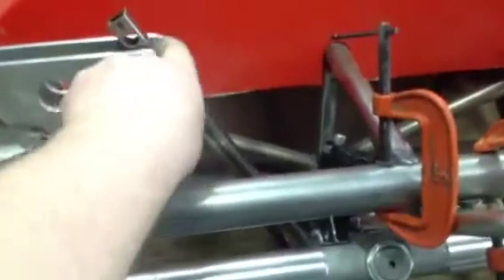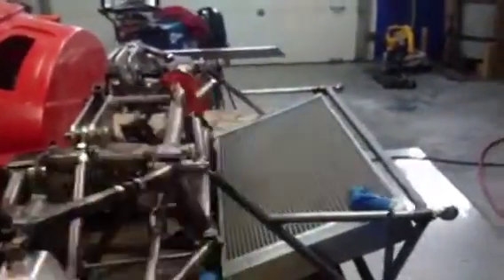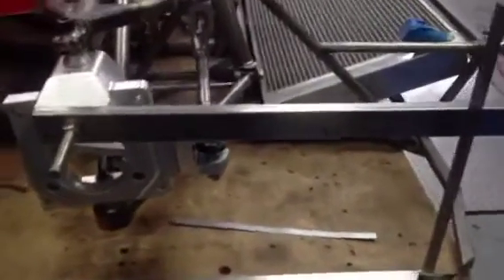This one's courtesy of spacers; this one has a ride height bar in, nailed to that point, so that would be full bump and full droop. I've lowered this down — I can screw the push rod down — I've set it up at ride height, come down 10, 20, 30, 40mm, which is maximum droop. On this side I've got nothing, I can't see any movement at all. On the other side it's about 0.3–0.4 of a millimetre. On this side again, from ride height to 10, 20, 30, 40, 50mm in bump — I've got 60 being the max, but I can't see it ever getting close to 60 because that would be on the springs and bump stop. Within 50 to 60mm, I'm getting less than half a millimetre on the ruler on both sides.